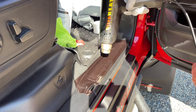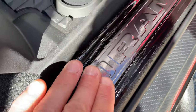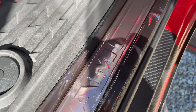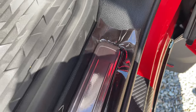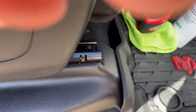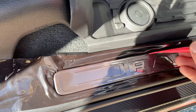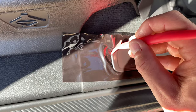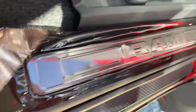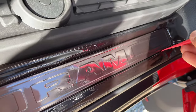Heating up this material — my phone died mid-film because it was a little too hot out in the sun. As you can see, I have it down where we don't have any bubbles in the raised parts. Now I just have to trim it. If you're doing it in the sun where it gets hot, the vinyl will get a little gummy. Once you get it pushed down, you're probably going to have a squeegee — you can use the edge of a squeegee. I have these little wrap tools that will push. You're going to want to lift up the edges and allow it to push in. Just give it a little push in there. Look at that — that's pretty freaking sick. That looks like black chrome, almost looks like it's supposed to be like that. Just give it a good push around the whole thing.